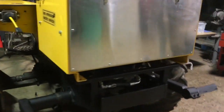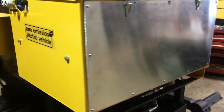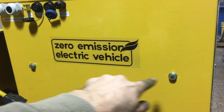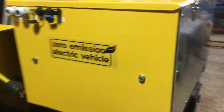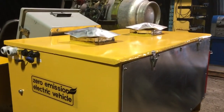The frame it sits on helps it to sit just above the motor. It's pretty dark under here, but you can see that it clears the motor okay. You can see the underside of the battery case is perforated, and that allows it to pull air on the bottom. The shelf that separates the two layers — so the first layer ends and then has a bit of headroom, no risk of shorts — and then there's a rigid shelf with another perforated section, so that airflow can go right up through and out through those guys as needed.